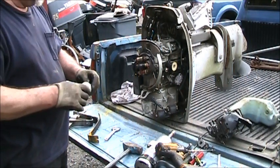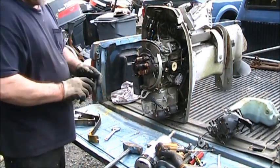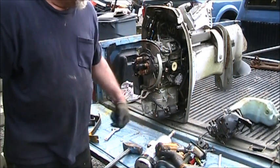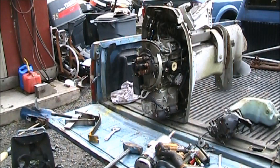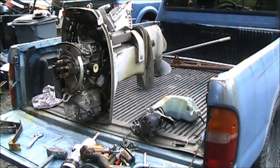We'll take this. Get over here on my rag, man. Little fuel filter. That'll be all I take it at. The propeller is shot, spun. I know that for sure. The lower unit, I'm not sure about. Well, when I say I'm not sure about it, I know it shifts, goes in and out of gear and all that, but so old, so salty, been sitting so long, I wouldn't sell it to nobody. It would just be parts. But the carburetors, you know, those are rebuildable. The starter bracket, and all that's hard to come by on these Suzuki DTs, older two-stroker Suzukis. So all that's worth keeping.